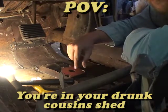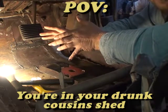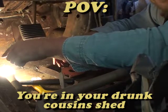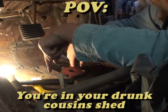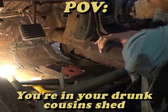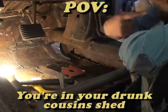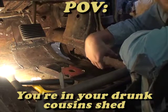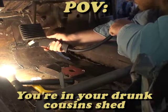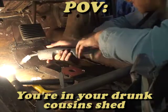There are chassis rails here and they're quite big. From the factory, they didn't quite understand the strength of unibody construction — monocoque construction — so they really did overbuild this car. Yes, it's a unibody car, however it's got a chassis rail that runs alongside the transmission, a chassis rail that runs along the floor, and then this giant sill here, which is very characteristic of Jaguars. It's like a huge box-section metal that runs from the toe board all the way back to the rear wheel arch. On the outside of the car, it's characteristically big — it's beautiful. Just go really slowly, don't direct too much heat into one spot, and just keep going. It's long but it's methodical — you don't have to think too hard about it.